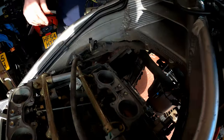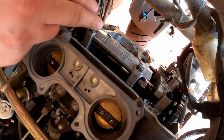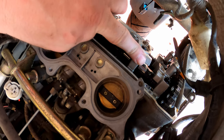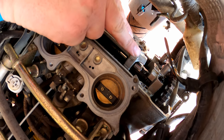The one thing I do want to stress that is different is the position of the cam lobes on the camshafts. On the rear, when the cylinder was on the compression stroke, the cam lobes were pointing upwards and towards each other. On the front camshafts, they point upwards but away from each other.